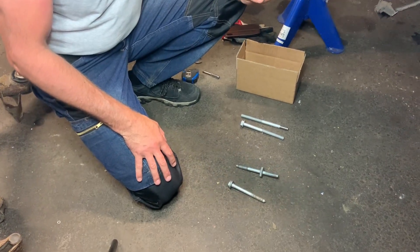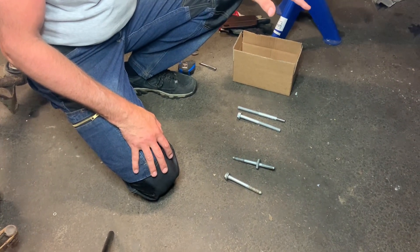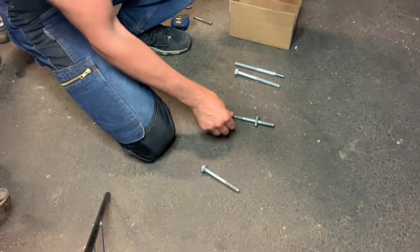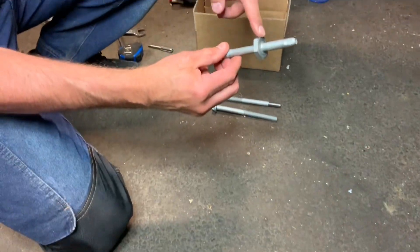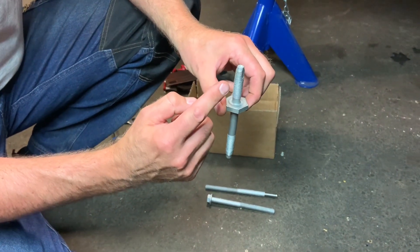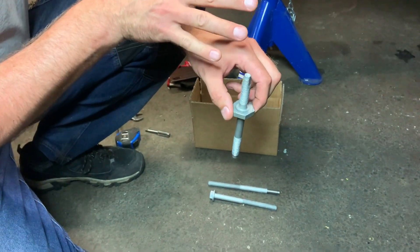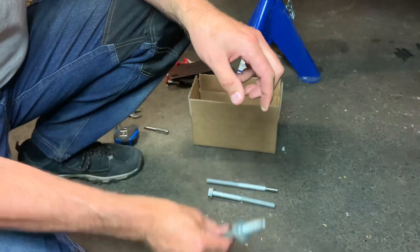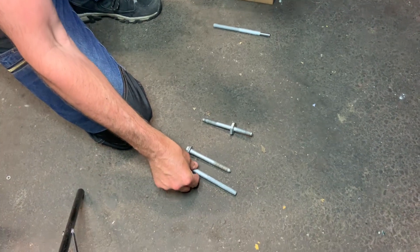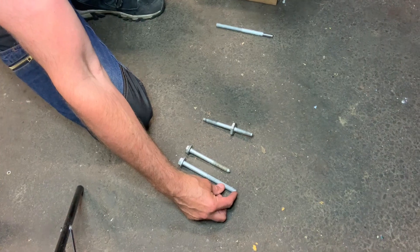Following up on the installation of the VINspar and the front gusset cups, we're now at the point where we want to install the bolts. This is the factory rear bolt, and this is the factory front stud with the hex piece. This is used to screw the stud up into the subframe mount — into the RSAP — which was originally a bottom hole. Now we have a through hole, and we want to replace these with the longer rear bolt from the VINspar kit. This extra length is to reach through the mount and into the VINspar.